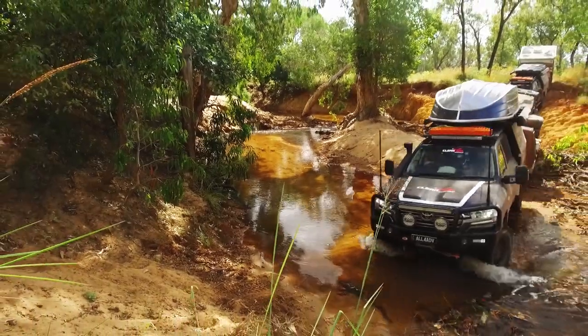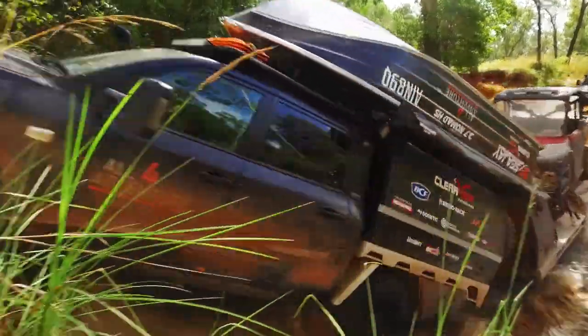I like to use manual mode because it helps me control the braking, especially when I'm off-road. If I was driving through soft sand towing a trailer, I'd dial my brakes right down. Because if I were to just touch my foot on the brakes, it would lock the wheels up and bury me into the sand, and I could get bogged.